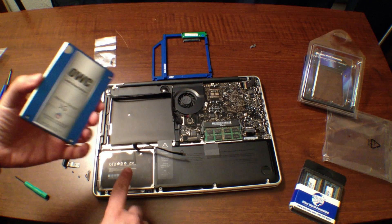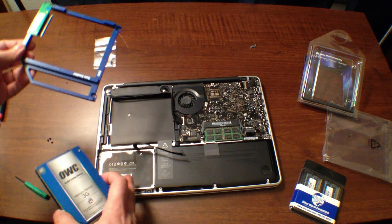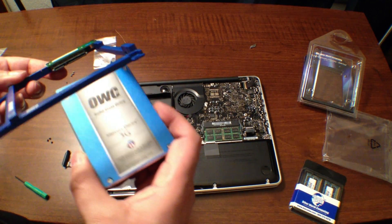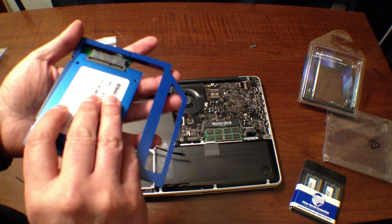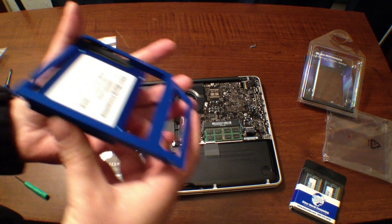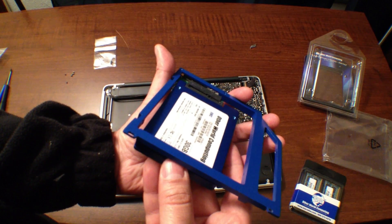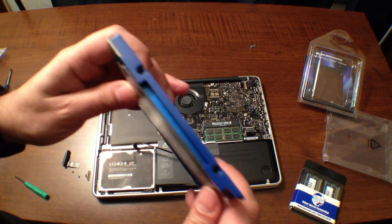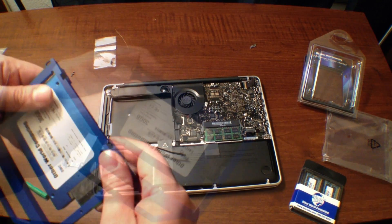You can see it's going to be my second hard drive. That's a nice thing about this whole upgrade — you can have a very fast boot drive and a nice-size one for a secondary. What we're going to want to do here is line these guys up like so and just pop in the drive. I'm coming in from the bottom — I think that's the best way to install it. Just hold it upside down, come in and line up your pins from the bottom. You can see them better. Just push it in and it'll pop right in. Now you're going to want to secure it with these two screws.